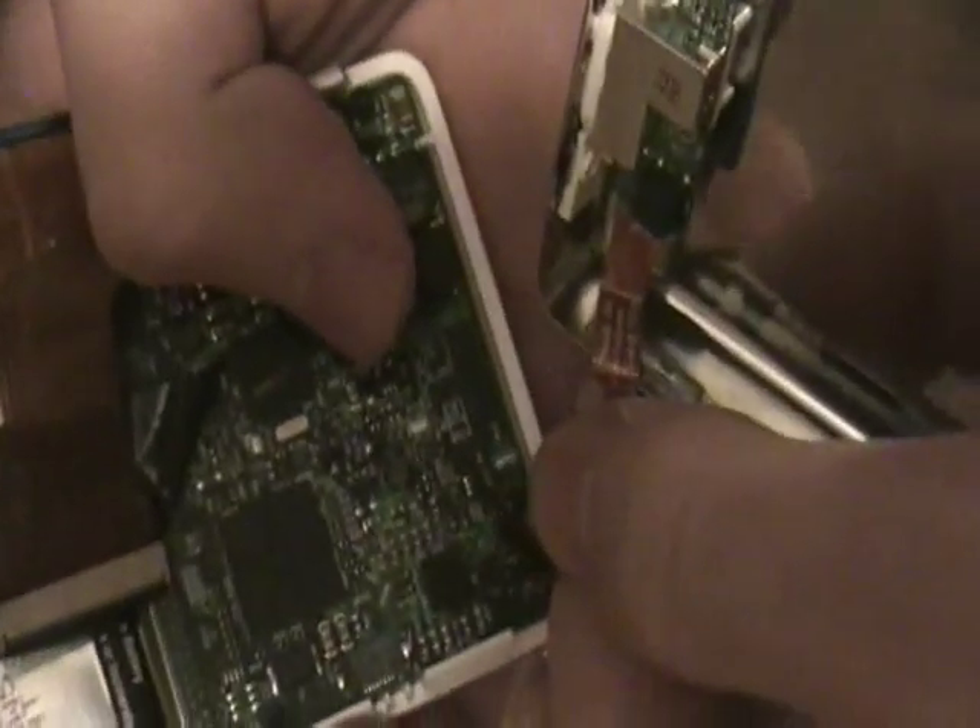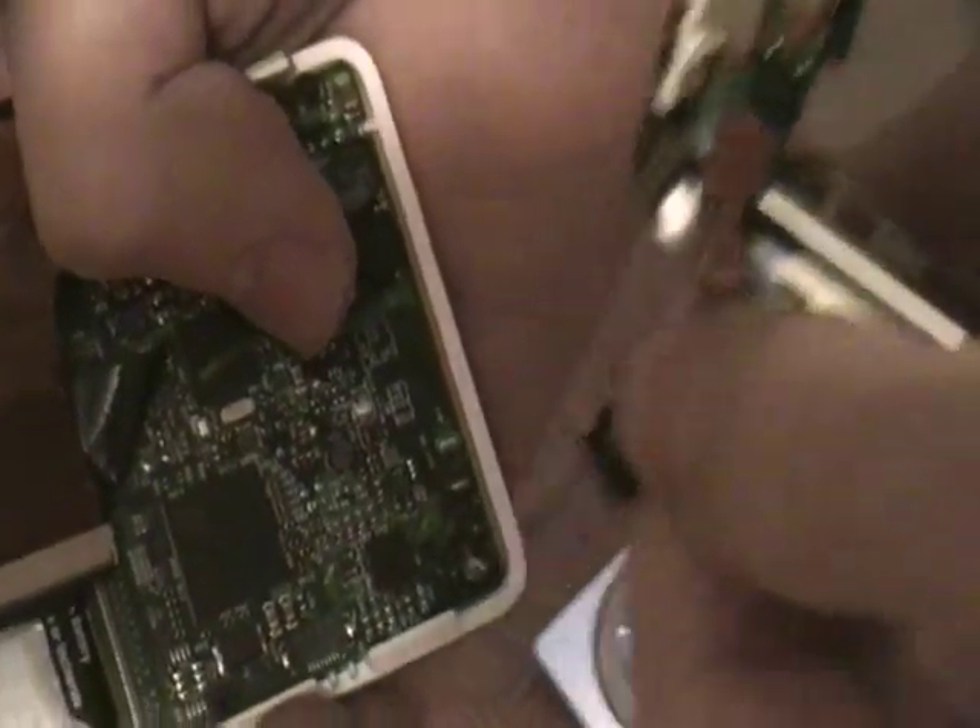Now this is already separated. There's a ribbon cable that connects to this area over here, so all you have to do is gently just pull it out, and that comes out. This will give you easier access to the earphone jack assembly over here. It's best just to pull that right out — it's a plug, you just gently pull it out, so it'll be out like that.